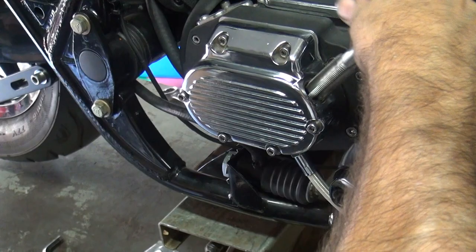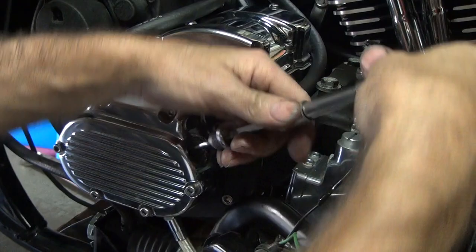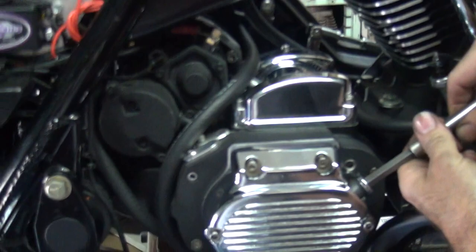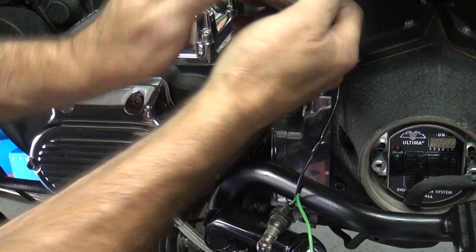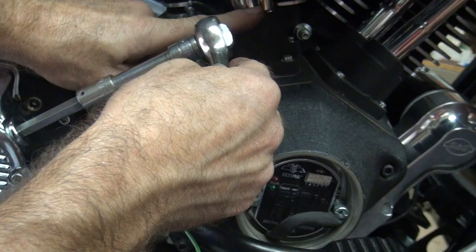Exactly what angle it's at. Okay, we're at a pretty good angle, right on this lifter block. That'll help a lot, because we've been up here instead of down here where we needed to be. You need to push in towards the engine to get the proper angle. Bingo, there it is. The first thread was mushed, and that was the problem. Had to clean the first thread. The angle is right with this lifter block, actually a little bit above it. So when you go to line it up, that's where you put it in.